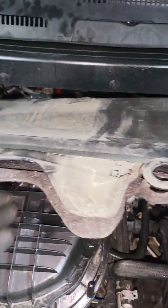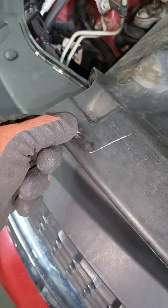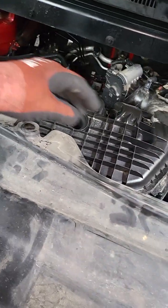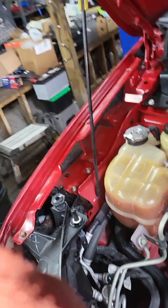This is the heat shield — it should be like this. It's down here, held with four clips and a back washer. Just remove those and slide it out like that if you want. After that, you're going to disconnect the plug.